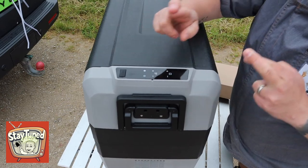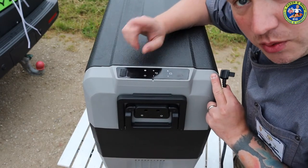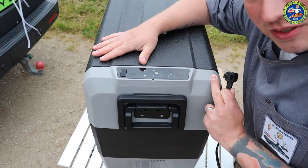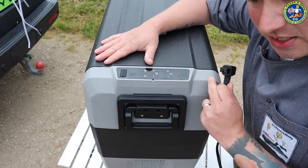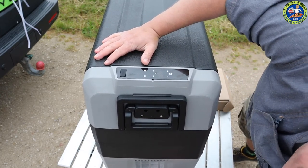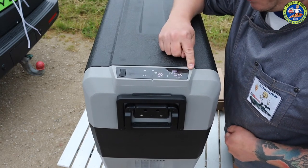We've plugged it into the car. Remember, before you plug something like this in, you need to wait at least six hours - ideally overnight - because the delivery person may have had it upside down or on its side, and you need all the liquids to settle in the compressor units. Just a little tip there. Also noted at the bottom: it's 24 volt as well as 12 volt, so if you're a trucker you may be interested.